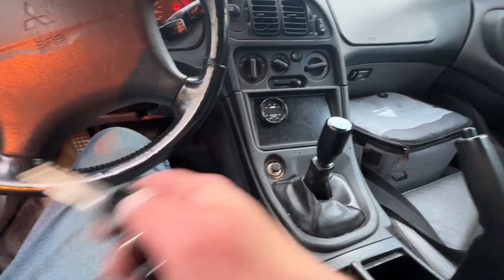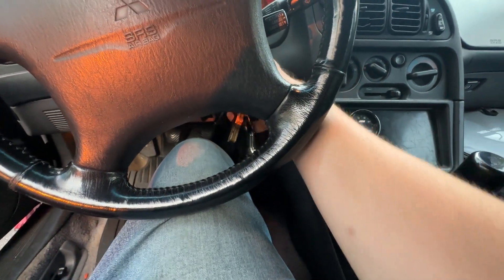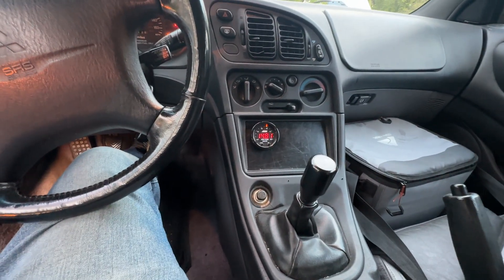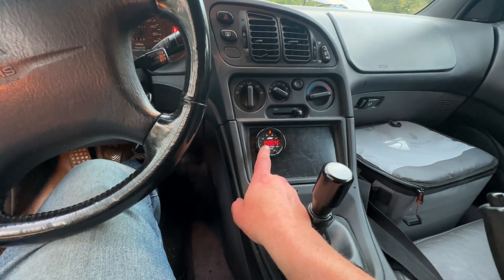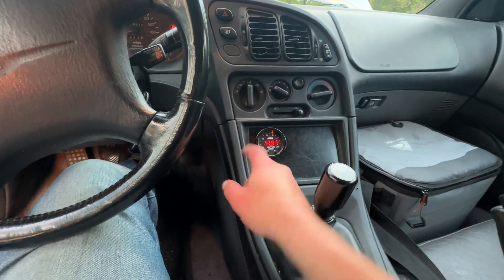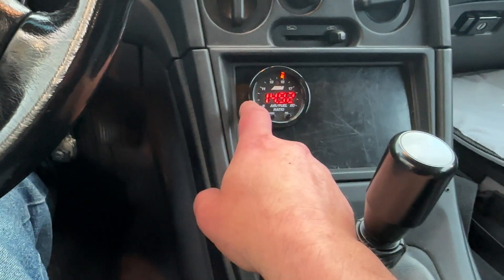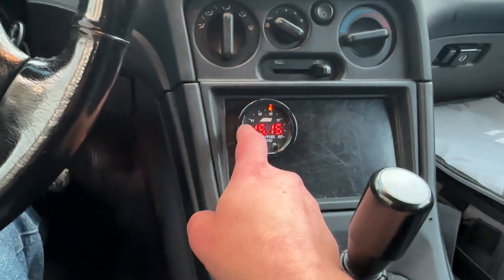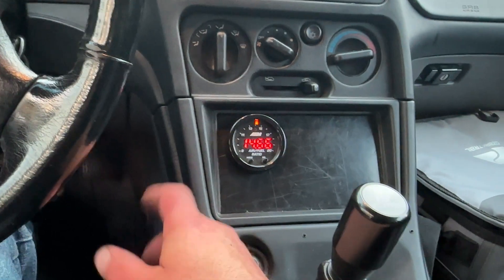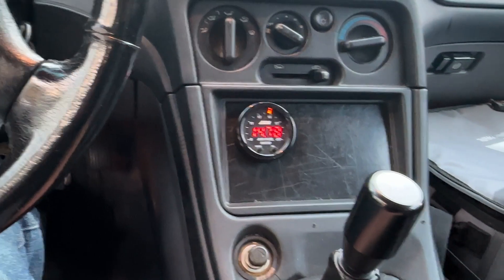Let's test-fire it and see what the numbers say. I know it seems stupid to say this worked, but this would not go 14.6 to 14.7 to 15.2 and fluctuate like this at all over the last couple of days. The old sensor was doing whatever it wanted, and once I got on the highway at about 50 miles an hour it was straight dashes — showing maximum lean — even though my app said I was running rich.